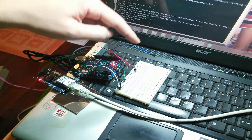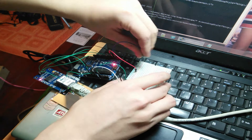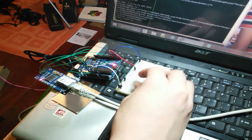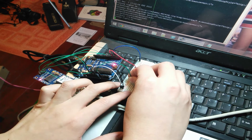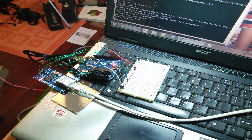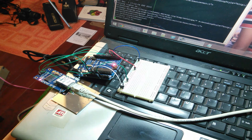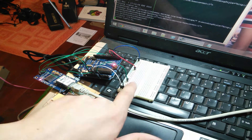Right now this is not connected to anything, which means the door is open. So I close the door. And now the lights are on, so I'm going to move that to the on position. You saw back there the text moved again — that was just because when I connected it to ground, I disconnected and connected again, which just made it think that I opened the door twice while the lights were still off.